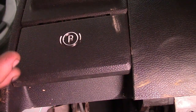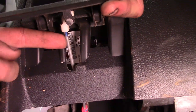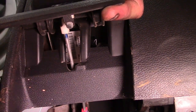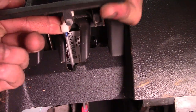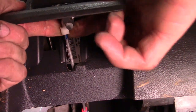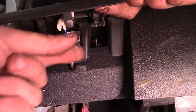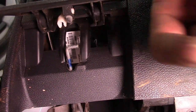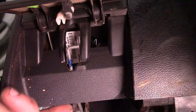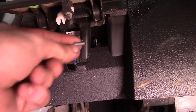On the driver's side one thing we need to actually unhook is the emergency brake release handle. If you pull up here you see this white piece and the rod — the rod is actually going through the dash and goes to the emergency brake assembly, so we need to go ahead and unhook it. The way to unhook it is via the white piece — you need to grab on it, squeeze if you can, rotate it down. Once you rotate it down you can actually pull the rod off. When we pull the dash off the rod is going to go back through the dash.